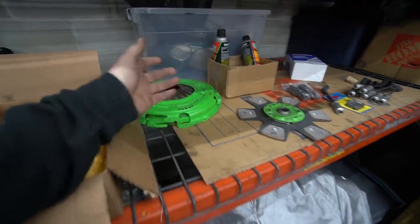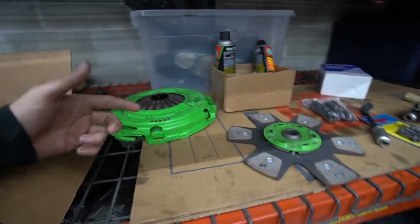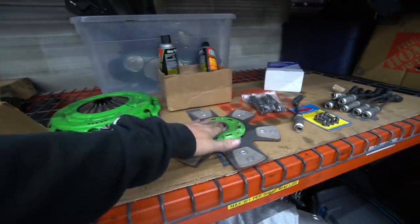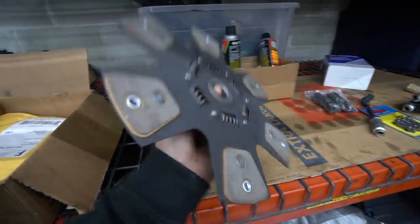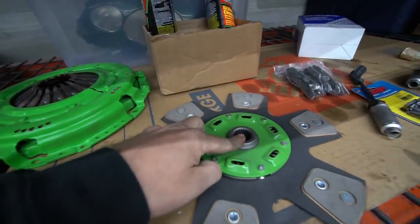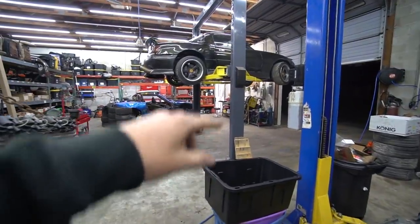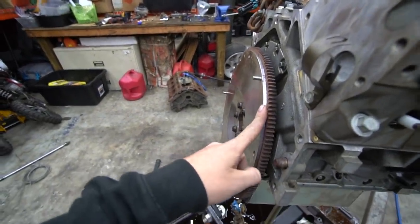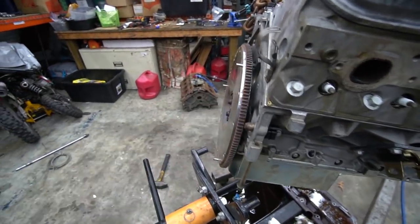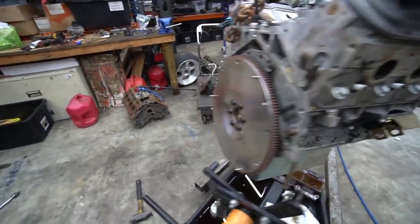I was talking to Monster Clutches when getting a clutch for the RX-7, which has a T56. I was like, it'd be really cool if you guys made a normal LS clutch kit with a 350Z center spline disc, and they said they already have that — they sell them all the time. They make a full-size F-body clutch disc, like what you'd find in their F-body T56 kit, but with the Z center splines. That is absolutely the way to go if you're doing a CD on an LS. Eventually, whenever I pull the motor back out of this car, I'll probably upgrade to one of their clutches. This flywheel is the lightweight one — it's 18 pounds. The stock one is 28 pounds, so it's 10 pounds lighter, and it's a super nice flywheel. It's got much beefier dowels, three of them — just a much better setup.